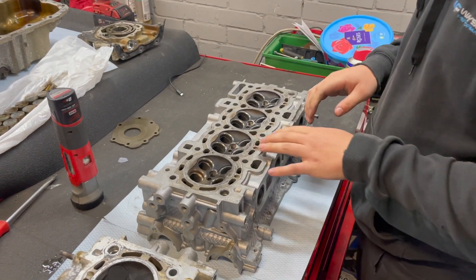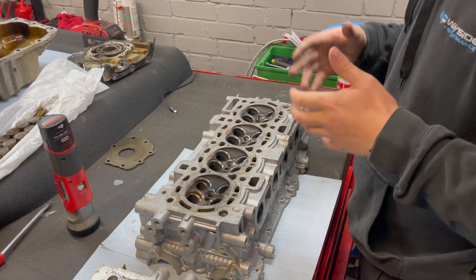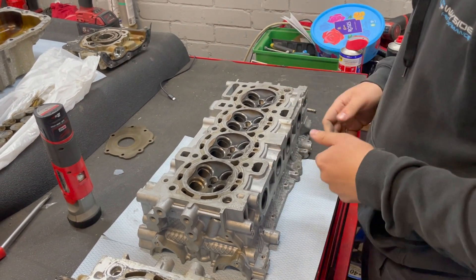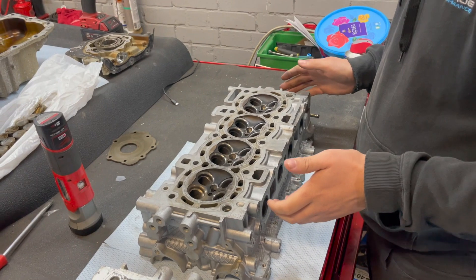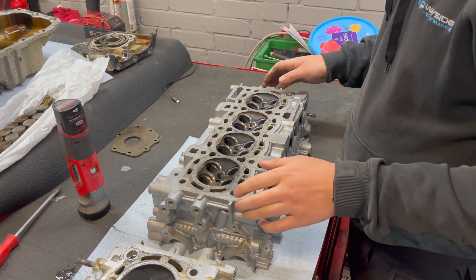When you're pushing these cars or increasing the power with bigger turbos, this is obviously not quite so efficient - you want more volume getting into your cylinders. So porting work - you could gain a lot of power from porting on these, which again we covered in our build video.